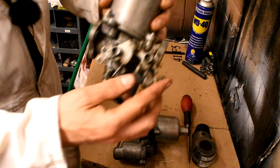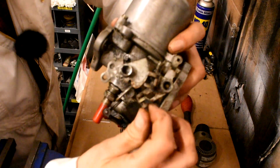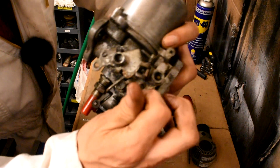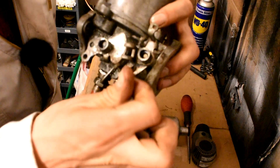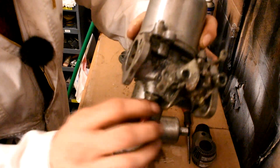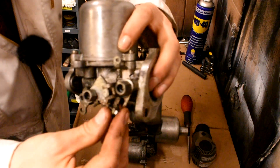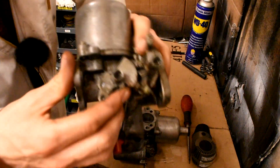What I generally like to do — and this little screw just here — is turn it back to about a feeler gauge gap away from this cam. So when the cam turns, it's literally just a feeler gauge gap, locked off with this nut. When the cam turns, all it does is lower the jet a bit more to enrich the fuel, and it allows a little bit more air into the carburettor. That feeler gauge gap adjustment is important.